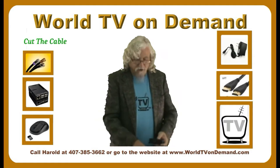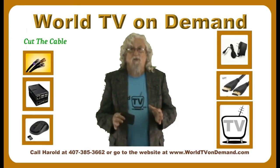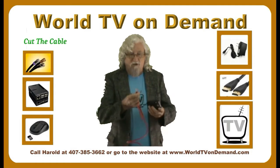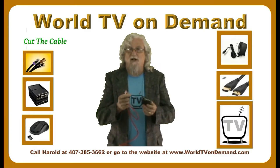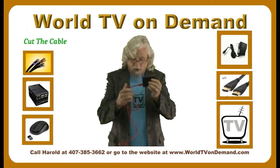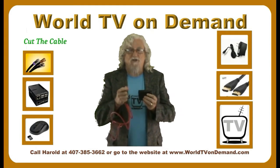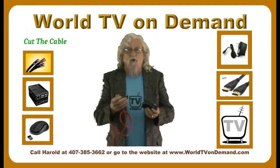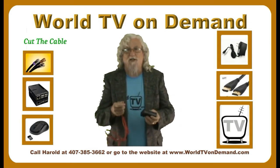Ethernet — this is important. If you're streaming video from the internet to your TV, Wi-Fi works great if you're close enough, but if you want the full signal, I recommend you use an Ethernet cable. My box has Ethernet capability — you're not going to find that on a Fire Stick. You just plug the Ethernet cable in and connect the other end to your router and you get the full signal. With Wi-Fi, it can be interrupted by other electronics, and it's just slower than using a cable. Anytime you can plug it in, it's better.